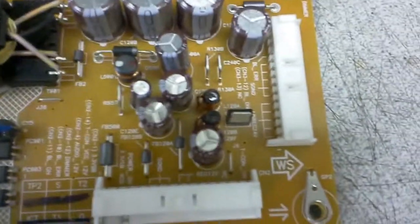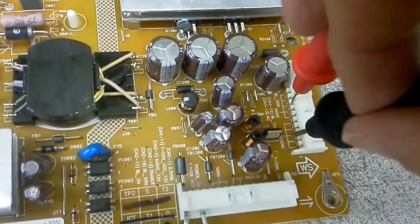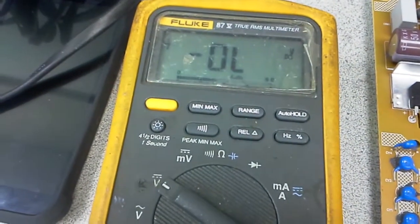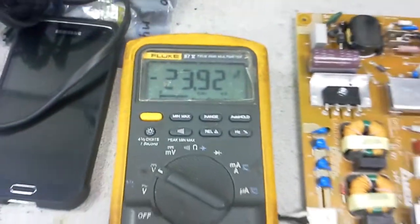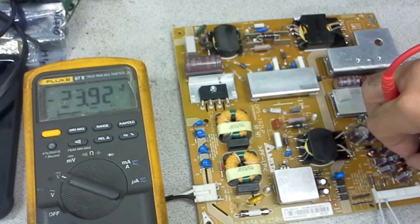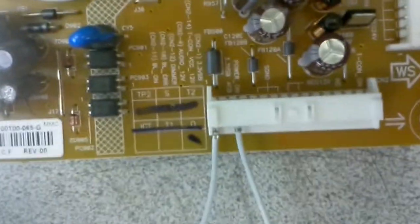Also 24 volts on the output will be present — 24 volts on the other connector, which is for the backlight inverters. It says unregulated. There are several pins that are shorted on the bottom — one, two, three, four, five pins — and then another five. Measuring that connection there, 23.95 volts. I'm holding the probes with positive to negative and not making perfect contact, that's why. But there you have 24 volts — this is basically what you need to have coming out of that power supply. Most likely it is working. There's also a regulated 12 volts that you can measure as well.